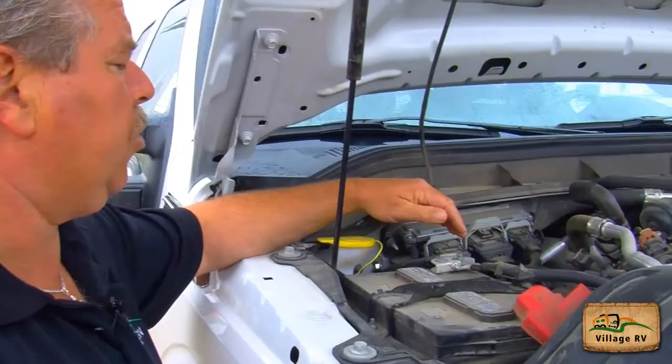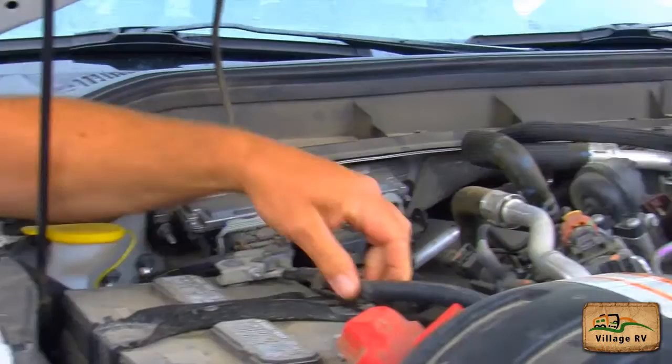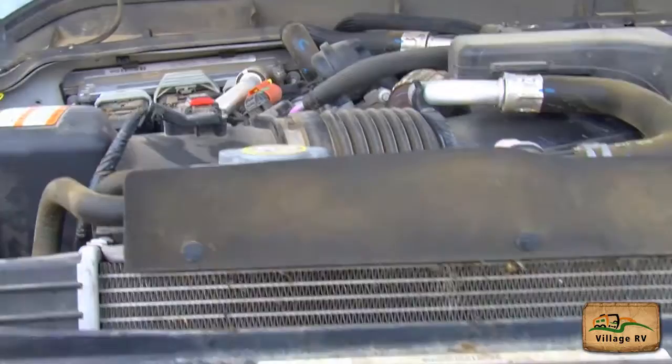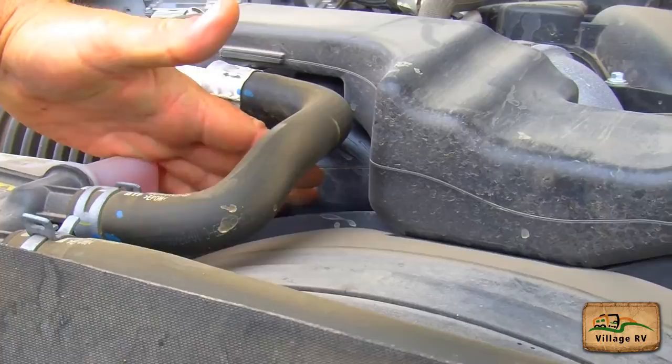Under the hood, this morning I checked my battery connections — they're all secure. My windshield washer fluid is full. I have no loose wires on this side of the truck. I also checked my air cleaner this morning and it is good. My radiator fluid is full. Snorkel and everything is secure. Moving along, you want to check the hoses — there are no cracks. The fan belt is good with no cracks.